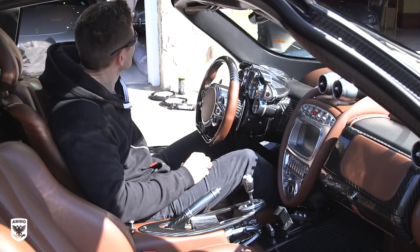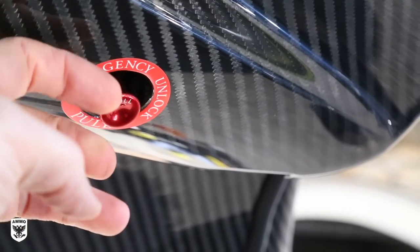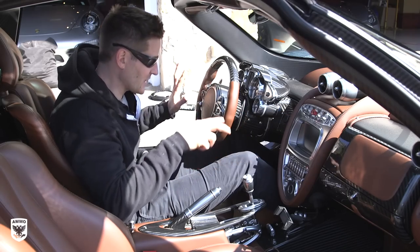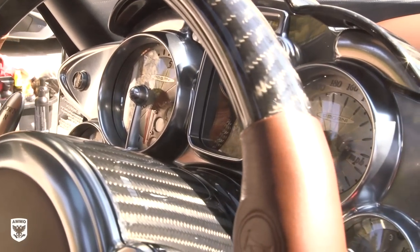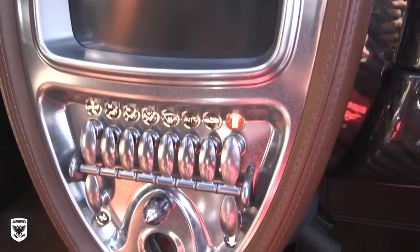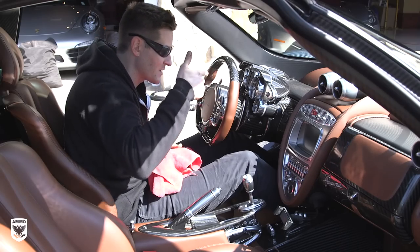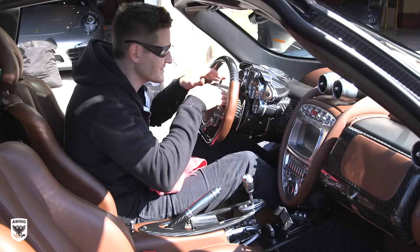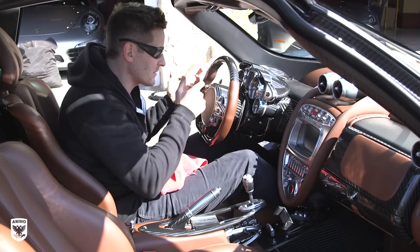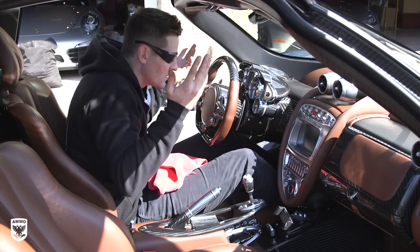One of the other cool things — there's an emergency button to unlock and get out. I kind of think of it as an ejector, because I do feel like I'm in a fighter jet. And one detailing thing I want to mention: there's lots of glass in here with a lot of beautiful artistry, and you really want to wipe it down with a microfiber towel. You can spray on the actual towel, and you can put a little spray wax as well since some carbon fiber here is coated. The big thing is, don't spray anything on the glass area, because it could seep behind it — and that goes for any car, a Huayra or a Honda Civic. I've seen it too many times where it stains the inside of the glass and you can't get it off no matter how much you wipe.